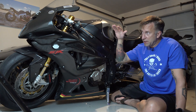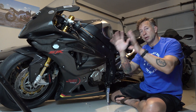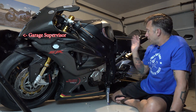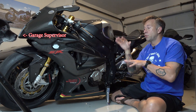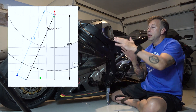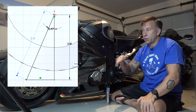The reason you want to lower it is because the smaller you make the bike, the less area going into the wind, which means less drag, which means you can go faster. So I lowered the whole bike — front suspension and rear. You want to make sure that you do it the same amount both front and rear, because if you don't, you start jacking with the rake angle on the front end. And if you get it too low, it might become unstable at high speeds and you'll crash.